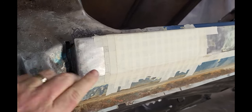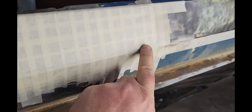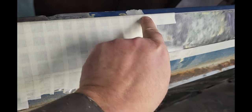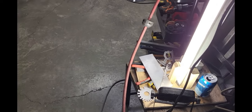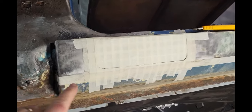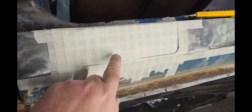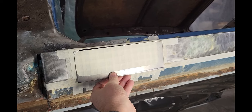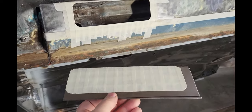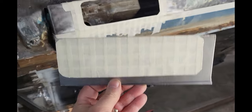I covered the hole with tape first going this way and then going this way, and if I press I can see exactly where the line is that I need to cut on. I'll go around that with a razor blade to cut that piece out and then it'll stick right onto my piece of steel. I do the straight areas first — the short straights and then the long straights — and then come back and do the corners. It's still held in nice and tight, and I'll get this cut out in no time. Just like that I've got a perfect template for my patch piece.